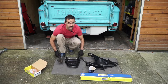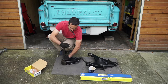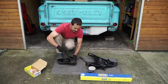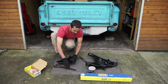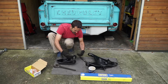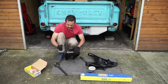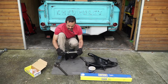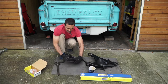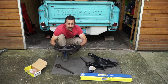Once it's in place you're going to want to try to center this as much as possible. These caps just screw on, so you're going to kind of have to play a little tug of war — screw this one in, screw that one in. This has to be in the center because it needs to move; if you tighten it up on one side it's not going to move. If you don't have a big enough socket, I just used a couple of open-end wrenches. Take a nice half turn that way, flip it to the other side, take it another half turn, making sure this is still moving and staying in the middle. If it quits moving you can back up one side or the other.